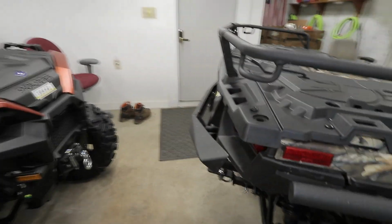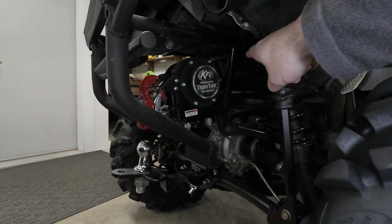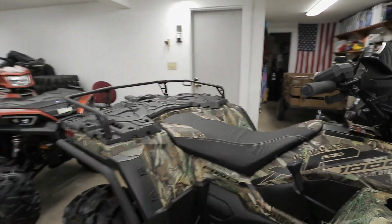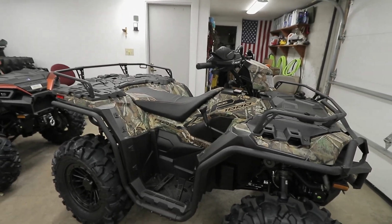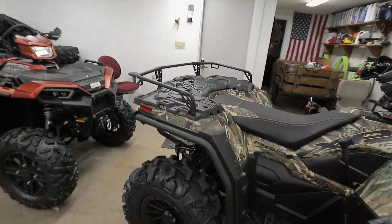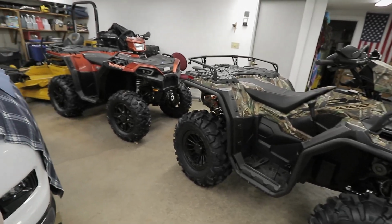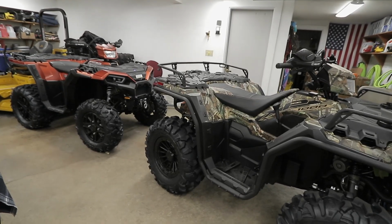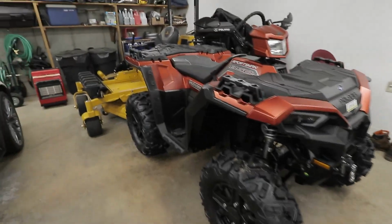Most importantly, it's the one for the exhaust for the clutch housing, which is behind the muffler in the middle here. That's the one that floods the machine often. I've flooded it probably about 3 times on this machine before I did the clutch kit. But I want to get a snorkel at least on that rear snorkel for the clutch housing exhaust, before we go into any deep mud or water, because I don't want to be cleaning out that clutch. It dries out in there, and then it's impossible to get out. So you don't want to get it buried and flooded. I just want to keep it clean from now on.